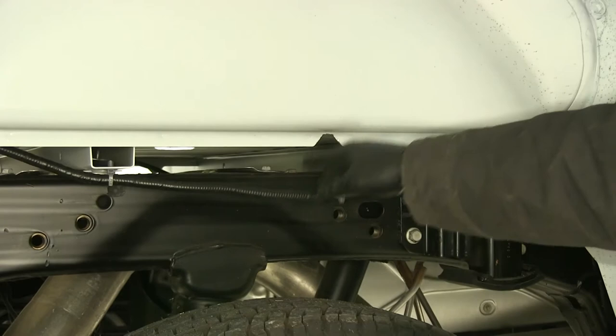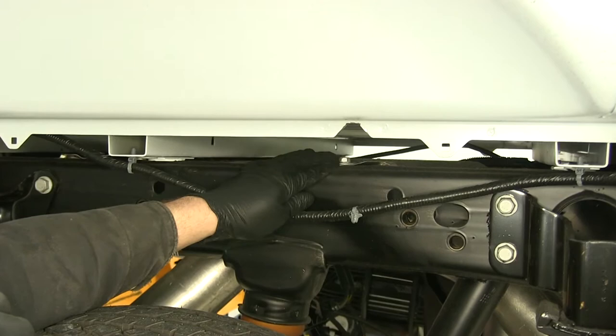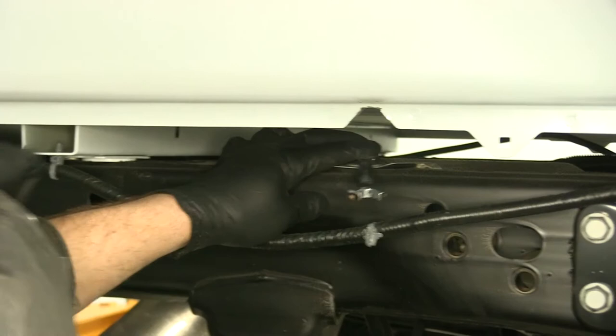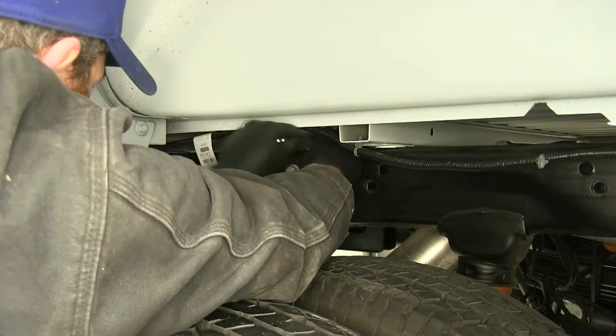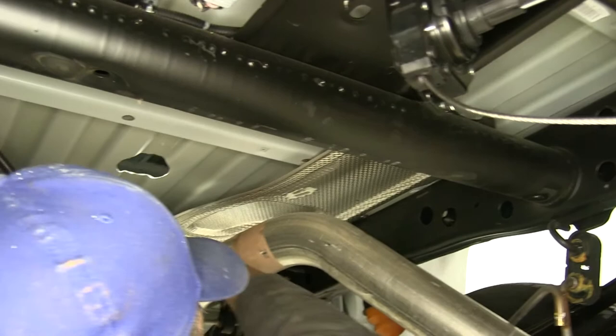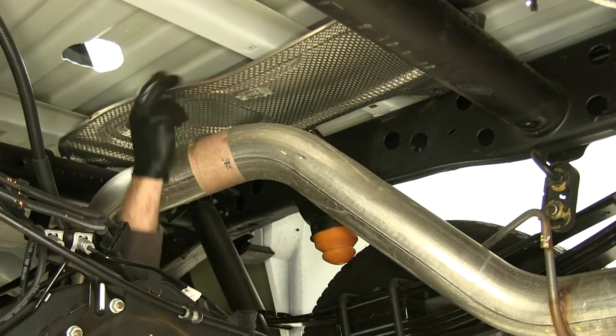With that out of the way, it should allow us to slide our rail in and out of there without any interference. Just behind that notch, we can see the top of a heat shield. This is held in place in a few different locations and we're going to be removing it with a 13-millimeter wrench. We've got two bolts here on the frame rail, one here and one here, plus one located right above the rear rounded crossmember, and another just ahead of where we created our hole. Once we've got the four of those out, we'll push it up over our frame rail and then pull it down and out.